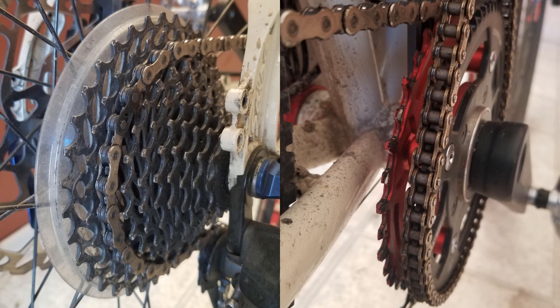The 28 tooth provides some good pull up steeper hills to get going. The 18 tooth is topping out at just over 60km/h on the downhill runs. I've not really had to use the 18 tooth much on the flat as I've been keeping up with traffic in the 21 and the 24 tooth sprockets.